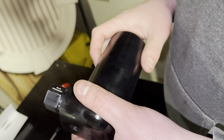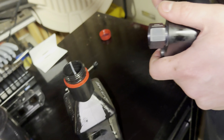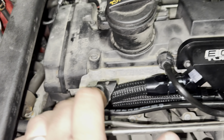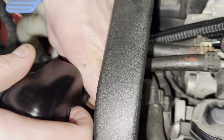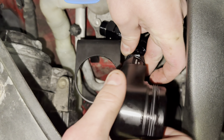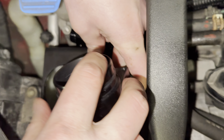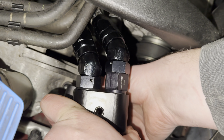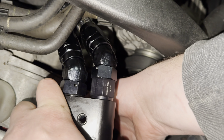So we're going to be utilizing the pre-existing hole. Let me just put this down real quick on the engine mount right here. This pre-existing screw area, and this hole down here on the body — it's going to be sitting like this. So now the bolt that comes with it, you just kind of screw it into the body. There's a hole that's already there from the factory that's not even used for anything — it's got threads — so just want to thread it in there. Don't go too tight. And now they give you a nut, and that goes right here.